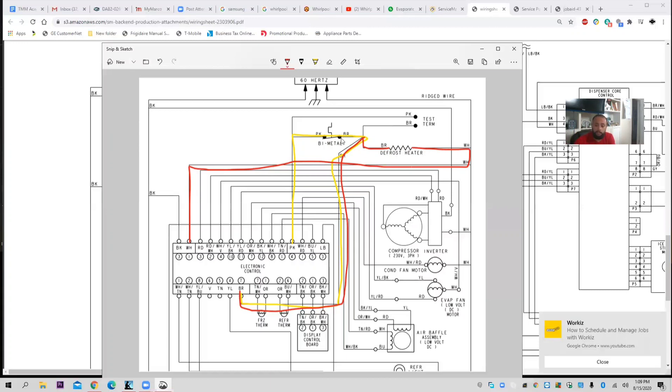Now, if you want to test them in series, you're going to test pink and white. Why pink and white? Let's follow L1 right to the heater. It comes in from the wall, energizes the board. Let's see where the board gets its neutral — blue represents neutral. You notice connector one and three are in the same Molex connector — that's how this board gets 120 volts.